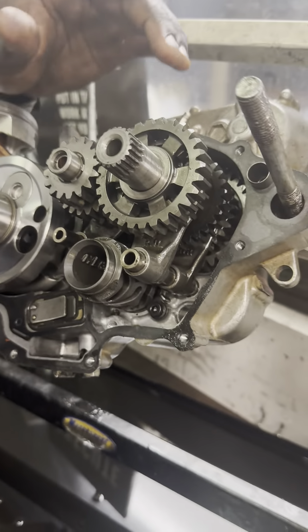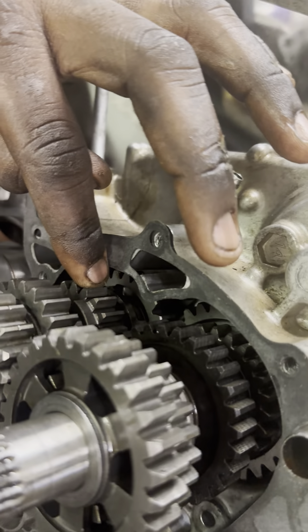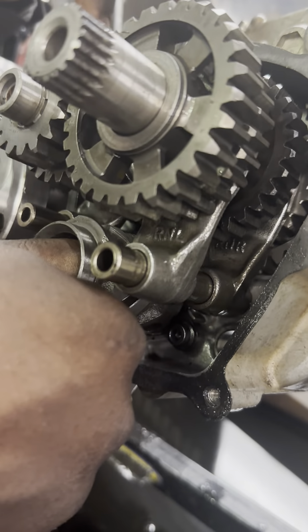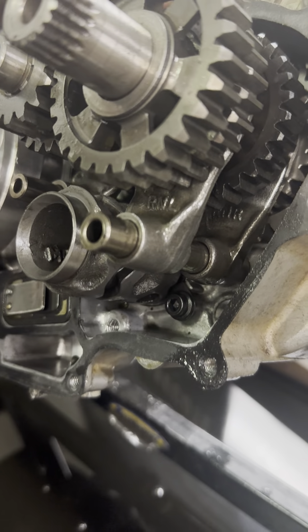When I want to go to second, I turn it with my hand and go up. So now I went up — this gear right here is second gear. You see the dog teeth from the inside right here. The left shift fork just rose up and engaged second gear with the pinion. Remember, the pinion is going to be the smallest ratio with the spur — that's the biggest. Second gear is the second smallest ratio paired with the second biggest gear in your basket. This gear right here is second gear.